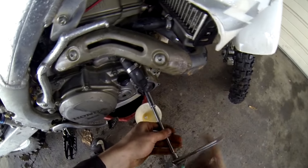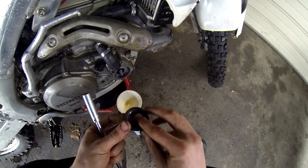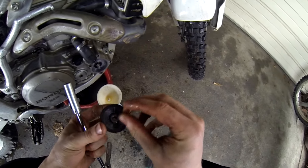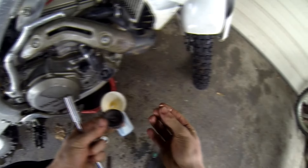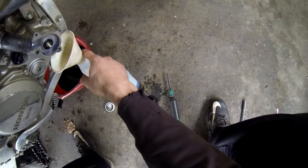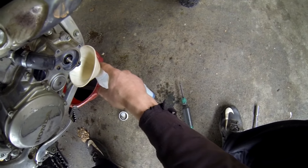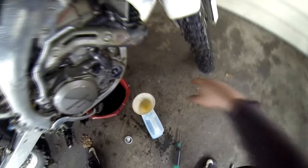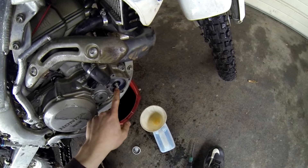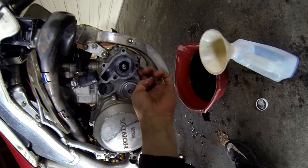Just remember it's also simple to take your entire right cover off — on the bench you can use a wrench and socket to easily take the impeller off. Note that there's a copper crush washer on the back of the impeller that goes on the shaft; you might as well replace that too. I'm going to show you how to remove the outer water seal. If you've put it on backwards, you can get it off here without removing the right side cover, replacing the gasket, and going through all that pain.